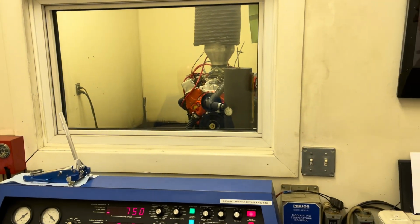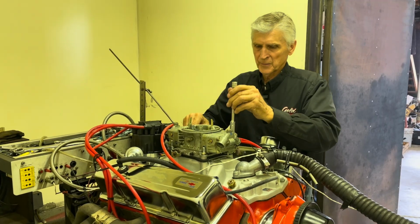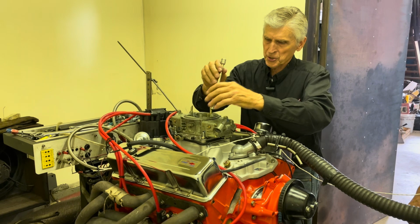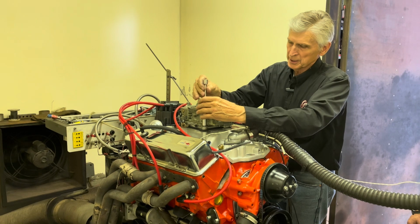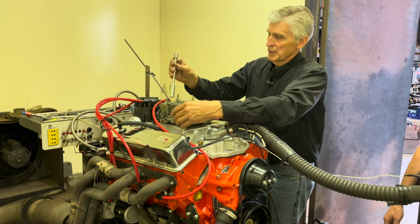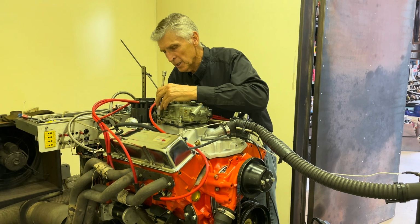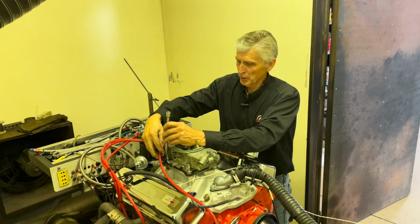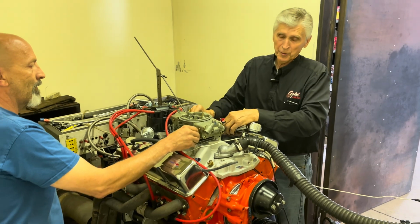Got your 350. We had one of the comments on my channel, from some circle track racers, and they use rules that are almost similar to this engine. Stock heads, I think the camshaft lift is limited to 450 or something like that. And that's about what this camshaft is. And so the question is, how much power can it make with a 500 CFM two-barrel carburetor? Don't laugh, because probably more than you think.